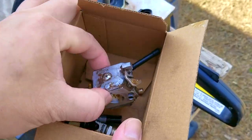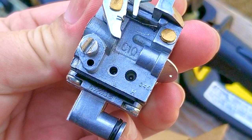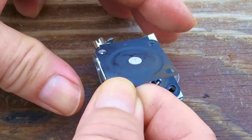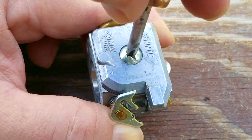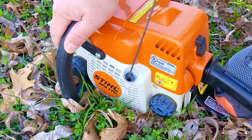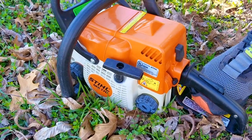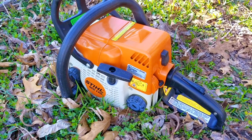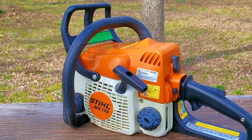So that's what it was doing when we first got it. What I thought was happening was that the aftermarket carb might have been faulty or that it needed to be adjusted to give more fuel to the engine. Unfortunately, you cannot adjust the aftermarket carb or even the OEM carb because the adjustment screws do not have any heads to turn. Luckily they gave me the OEM carb, so I serviced it and tried it again, since the OEM carb is a lot better quality. After servicing the carb, it did exactly the same thing — I still believe it's running out of fuel and it wasn't the carb's fault.